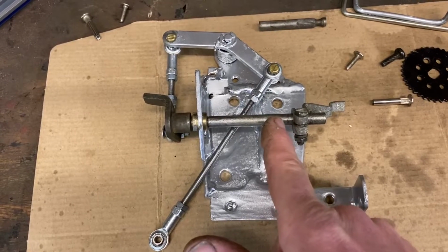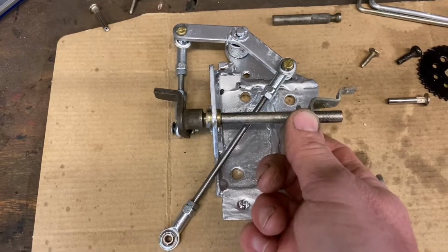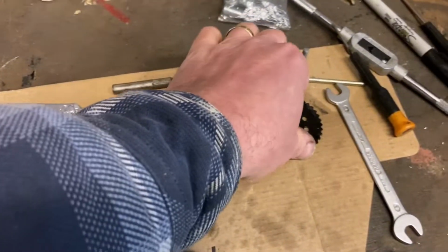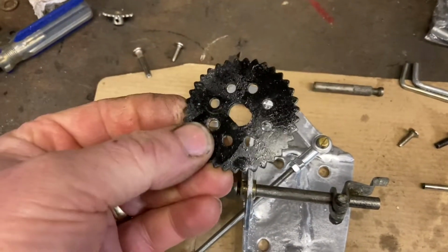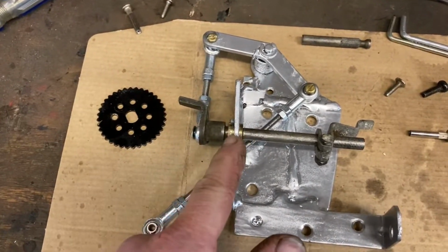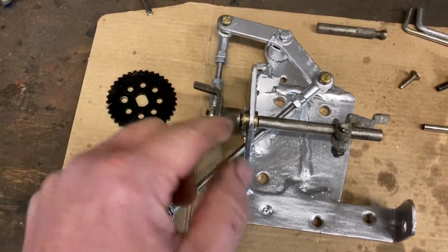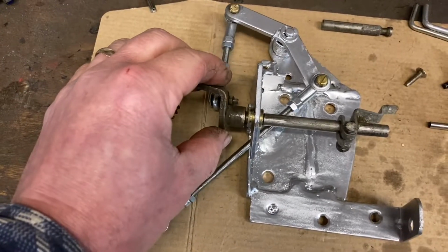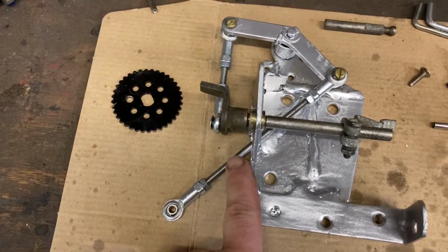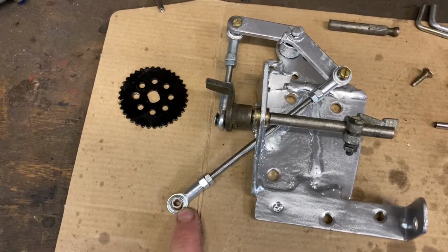Center punched up this shaft to give the actuator something to grip on. Also, the old Meccano cogwheel had to take one for the team. He's donated this bush, so we've got a proper bearing surface there now instead of a tatty rubber grommet. And the rods are just M5 plain stud with rose jointed ends.